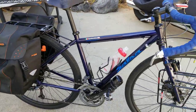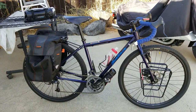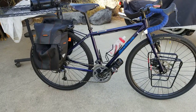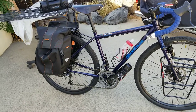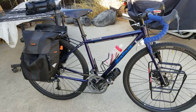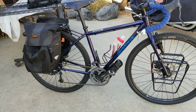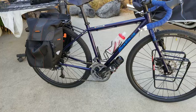If you're looking for touring, loaded riding, something very traditional, my Salsa Marrakesh has a triple chainring with really wide gears in the back — I think it starts at a 12, ends at a 36. The front has an inner chainring that's a 24, so it's three chainrings up front, which is traditional touring, with a long cage rear derailleur. This is an all steel bike.